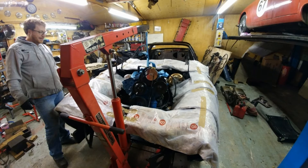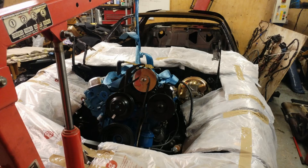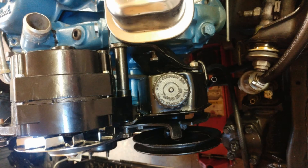When I eventually went back in there I took a photo of the aftermath — it burnt the ceiling. It was a foolish, silly thing to do. I'm lucky to be here. Eventually got over it. This is where I met my friend James — still a friend to this day — and we started fitting the engine into the car. We couldn't get the headers on; it was a nightmare. After lifting the engine in about God knows how many times, I spent ages trying to work out where the trans cooler lines run. The two silver pipes come out from behind the oil filter, go underneath the engine mount, and then come out. I searched the internet and could find no diagrams. If anyone has any info, that would be really helpful.